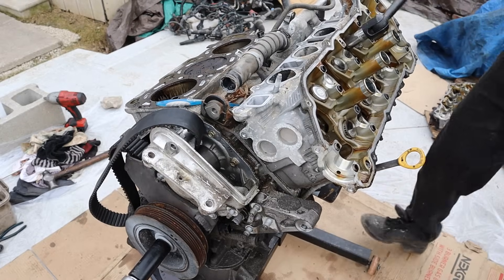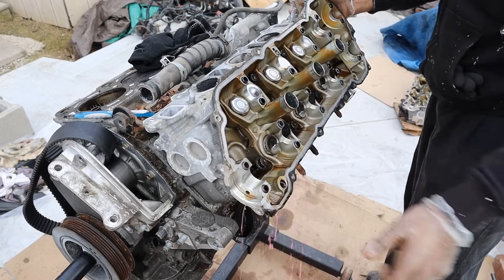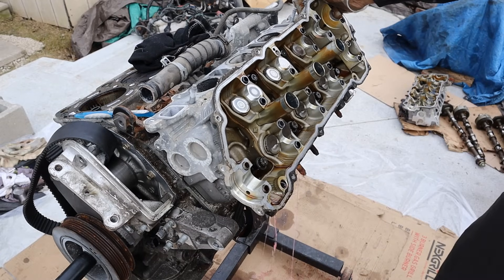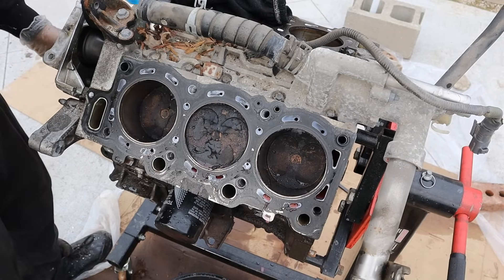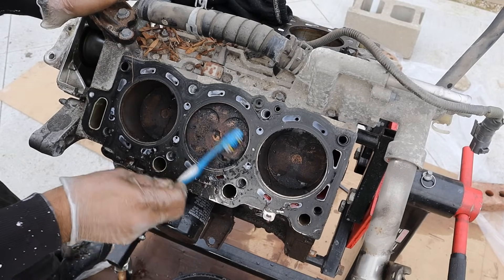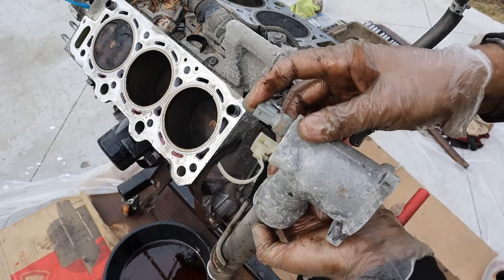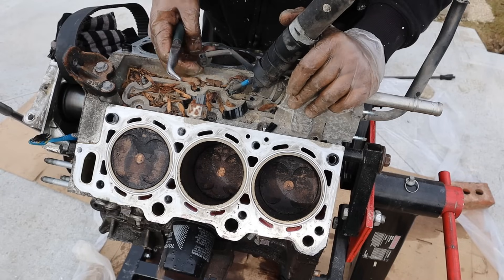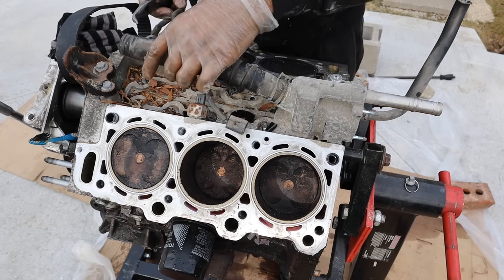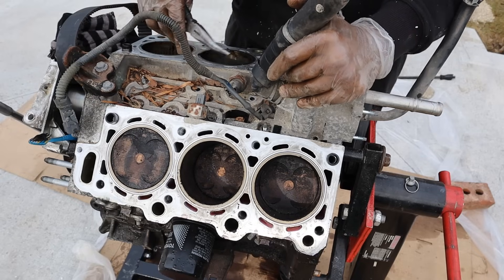Pulling the other head. It's actually a good thing that the coolant is pink — that tells you this has been dealer-serviced with the proper coolant. Now the pistons that face the front are actually in worse condition than the back; look at this middle piston — there's a lot of carbon flaked and built up here, though I don't see any major mechanical issues. The knock sensors are known to go, especially on the newer 3MZ engine, and the wiring harness itself gets pretty brittle. You can hear how crispy it is — that's because it sits down in the V where there's a lot of heat cycling.